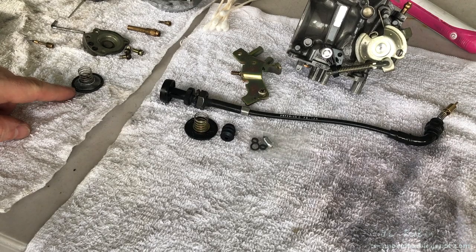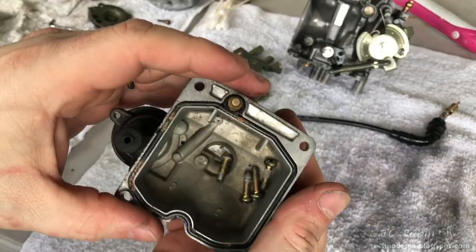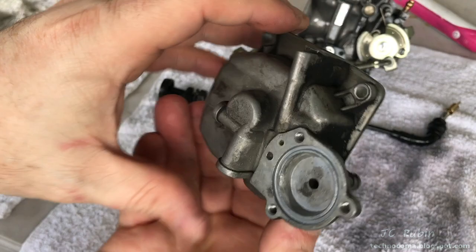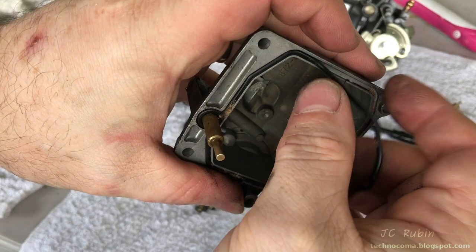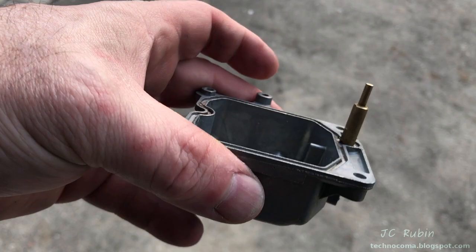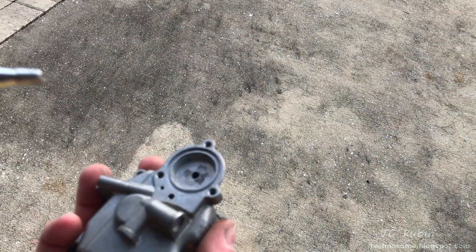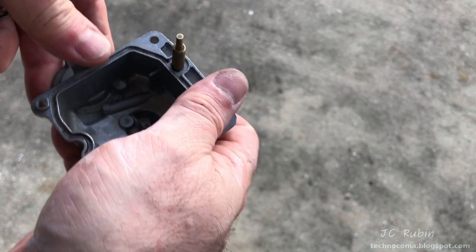As part of the rebuild kit we're replacing the diaphragm and spring. We also have four pieces of the float and two o-rings for the bottom of the accelerator pump. Working on the float bowl now — pulling off the old seal piece and replacing it. Everything is relatively clean but we need to remove this seal, and it's petrified — as I peel it up we can see some corroded areas. After preliminary cleaning with carb cleaner, all passages are blown out with no obstructions. The accelerator pump jet is confirmed clear and the pump hole passes air.